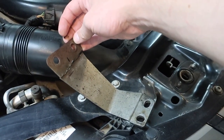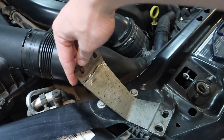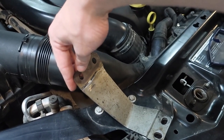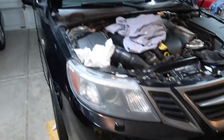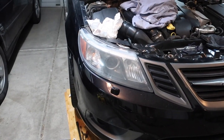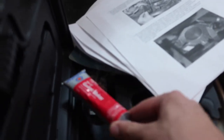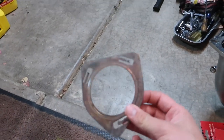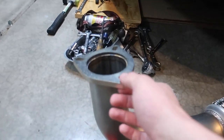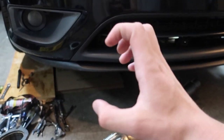On any cross-wheel drive V6 — so an AWD Aero or a Turbo X — you're going to need to modify this bracket. If you look on Krona's website and follow along with those instructions, you'll see more of what I mean, but this is going to have to be modified and welded back together. We are so close to completion on the Turbo X. All we have to do today is fairly simple stuff — just put some RTV gasket maker between the turbo and the down pipe, then between the mid pipe and the down pipe along with the old gasket. We attach the mid pipe to the down pipe, the other end slides into the rest of the exhaust, and there's a flange around there that will tighten down.